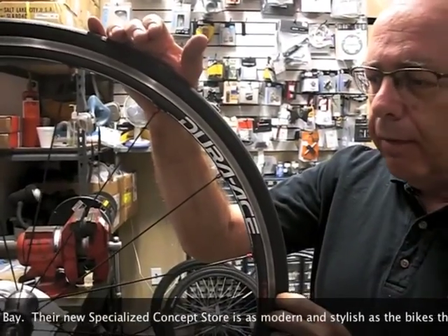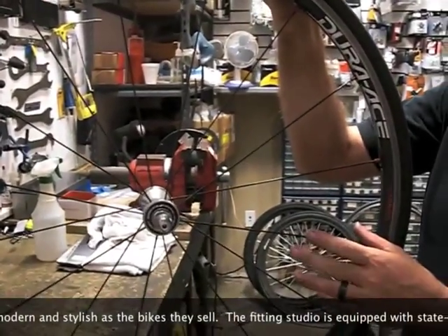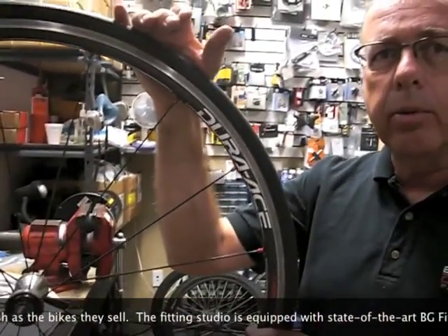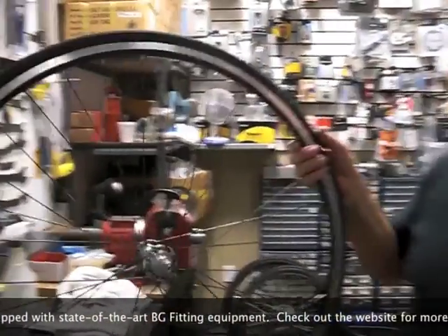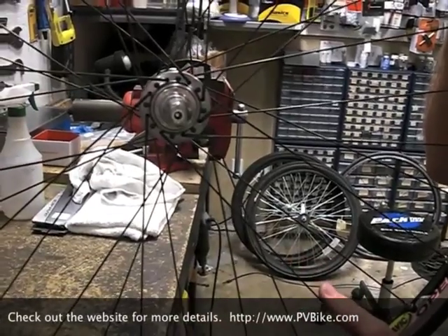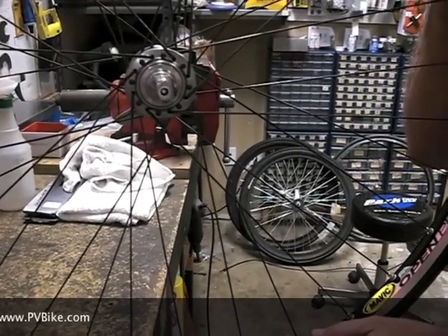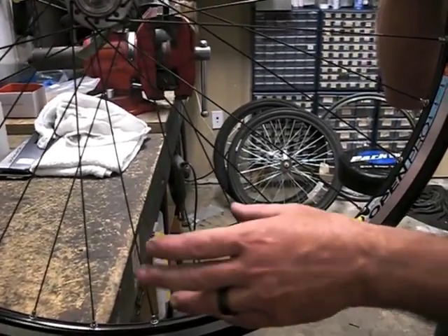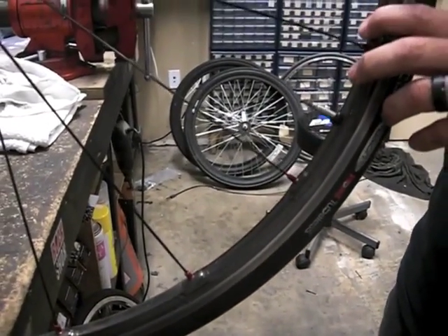The downside is if the bike hits a hole in the road or is involved in an accident and comes out of true, we have a lot less spokes to work with to retrue this wheel, maintain its tension and integrity. On the older 32-spoke wheels, if something happened, we've got a lot more spokes we can work the tension with or replace if damaged. Also, with this aluminum rim, we can completely remove the tension, straighten the rim, retension it, and salvage it. Where a rim like this one, if it's damaged with the carbon fiber, we're pretty much going to write it off as a total.